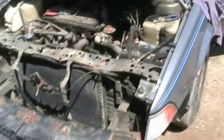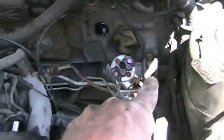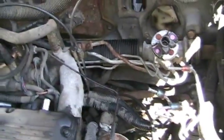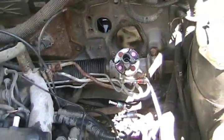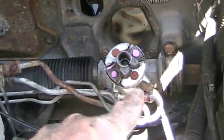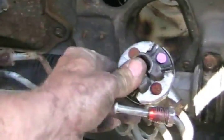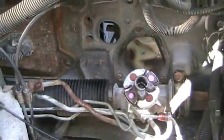Well, now you can see why these cars are most suitable for this application, because the steering rack is mounted halfway up on the firewall, unlike most other cars where it's mounted down below on the subframe. And you can unhook those clamper things in the steering rack, flip the steering rack over like we did, and put the clamper things back on, and it still fits. So it's got this rubber U-jointy thing here, so that'll adjust to any angle I need to run my steering shaft out to my contraption.